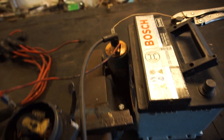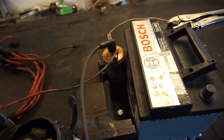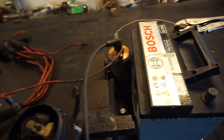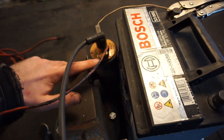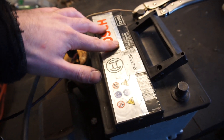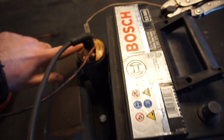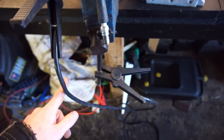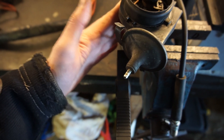So how does that help with the coil? The coil has two windings in it - a primary and a secondary winding. They will differ from different coils; you might have a three ohm coil or a one and a half ohm. It all depends on if you have a 12 volt system, 6 volt system, ballast - there's a lot of things, but I'll just set up a really basic 12 volt system here. So you have the primary winding, and in the primary winding you get battery current. You can see hooked up here the positive up here to the positive on the coil. The negative of the coil is actually connected over here to the points, and then the negative is hooked up to the ground of the distributor, which would be the ground of your car.